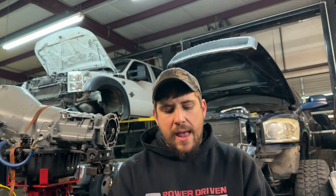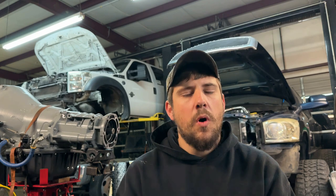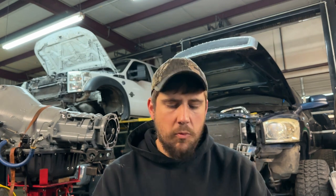From there you are safe to put coolant in. After that, you'll do one more hot re-torque. Usually what I tell people is to drive around at half to two-thirds throttle — basically if the truck makes 40 pounds of boost, try not to go over 30; if it makes 100 pounds of boost, I probably wouldn't go over 50. Then you rip it apart again while it's hot and torque it down. It's not uncommon for them to move anywhere from a quarter to an eighth of a turn; sometimes they don't even move.